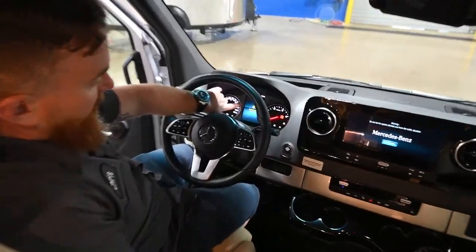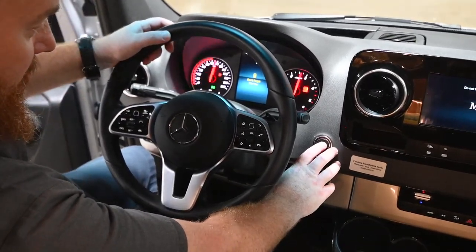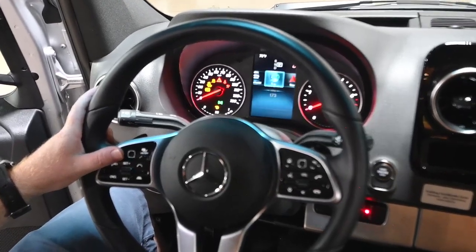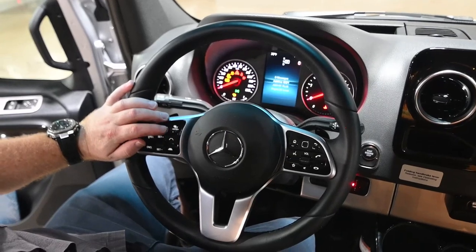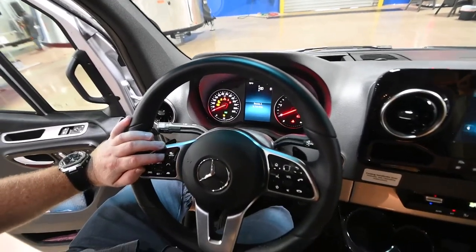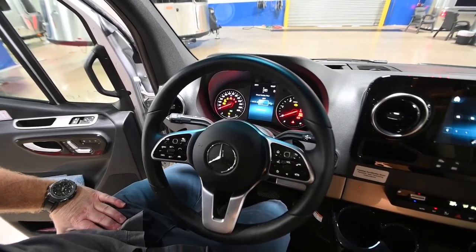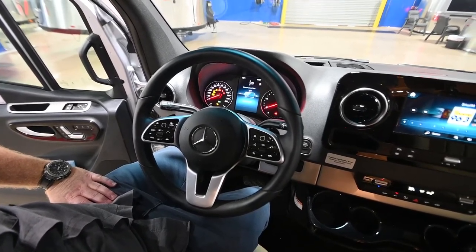You have your dash display here, controlled through these buttons. The diesel emissions fluid level is displayed here — currently 100% full. There is a service due in 725 days, and it's going to be a Mercedes service, not an Airstream service. We'll go to the particulate filter — in this exhaust system is a diesel particulate filter. Once that filter reaches 100% full it's going to do an automatic regen cycle. Do your best to continue driving during that regen cycle, because when you turn the vehicle off it will reset, prolonging the time it takes for the particulate filter to clean itself.